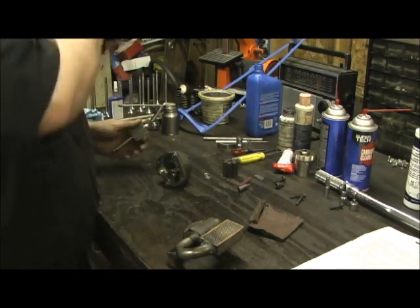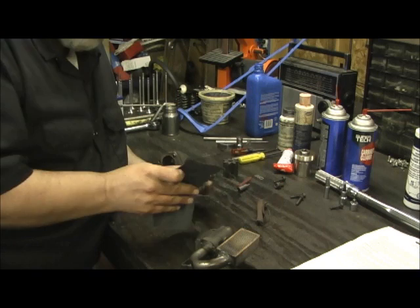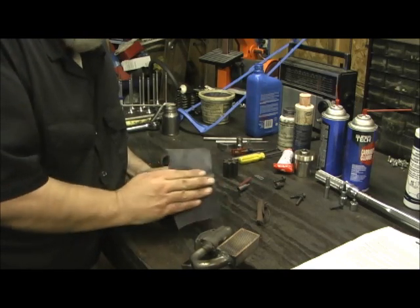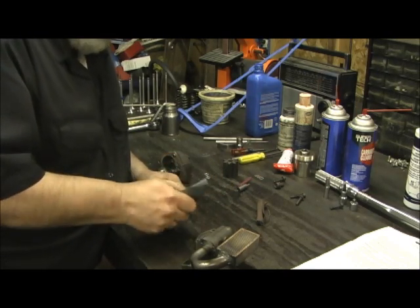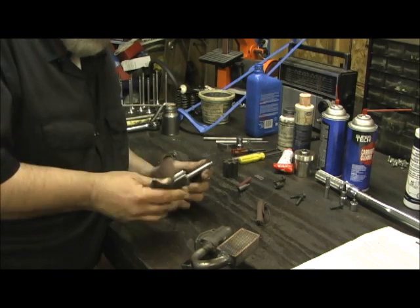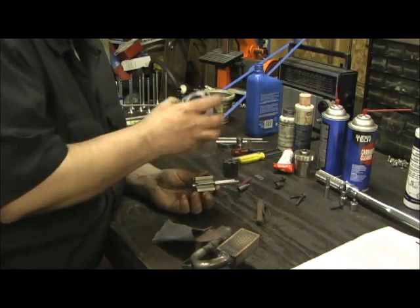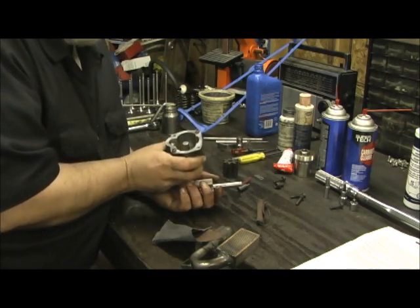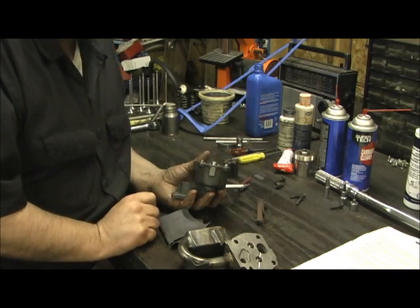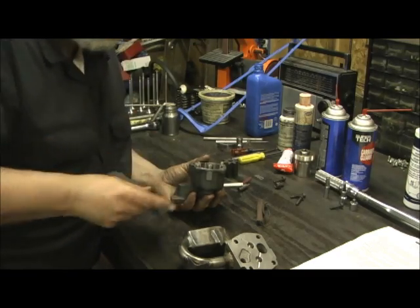One of the things I pay close attention to - and I learned this from my old friend David Bazaar - was to take these pumps and spend a little time, I mean a couple of hours. This is your motor. Go over these pump gears and touch them and kind of smooth the edges of them. There's also a file thing you can do to them, but for the most part these new black box pumps, they've done an excellent job. It is an entirely different pump, a lot better design, and the oil cavities, the chatter grooves, and everything else - but it still leaves a lot to be desired. Don't just drop the things in. Quality control, remember guys.